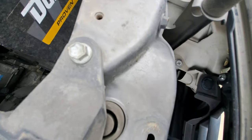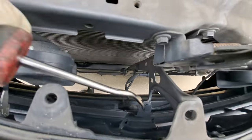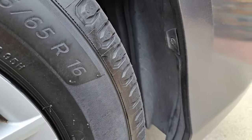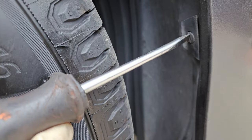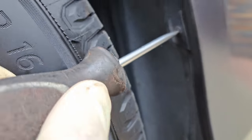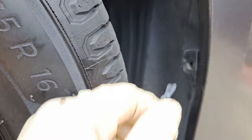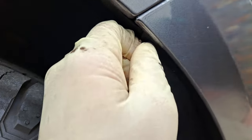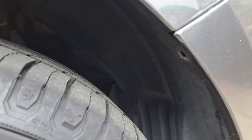One on each side, one over here too — get those out. There's actually a third one right there. Come to the side of the bumper here. You have a flathead right here — that's going to be a 90 degree turn, either way, and then it should just come out. There it is. Then you also have a plastic screw right there — get that out.